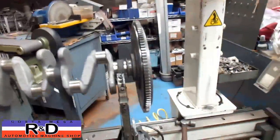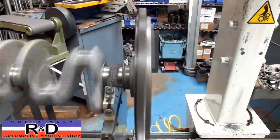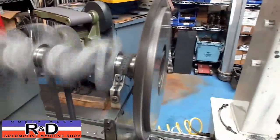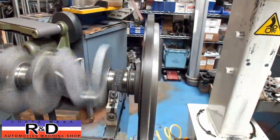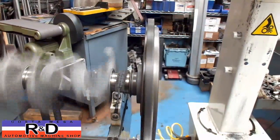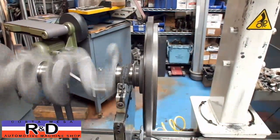I'm going to start this. What I want you to do is watch the ring gear on this thing here — let's see if the flywheel is nice and steady. With the ring gear, somebody's trying to take it off or something, because it's wobbling like crazy. So this is just one of the things you have to check before you balance a flywheel, just to make sure the ring gear is on correctly.